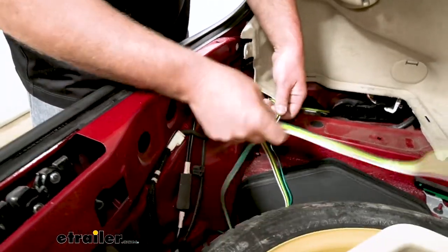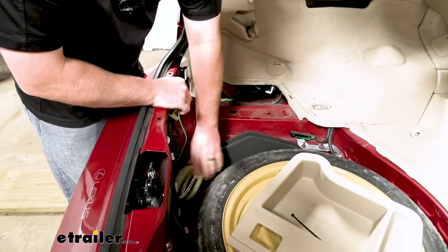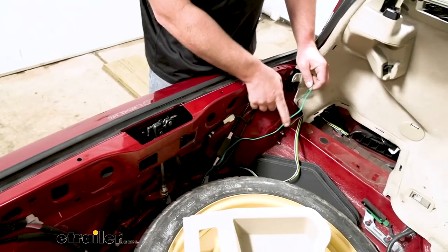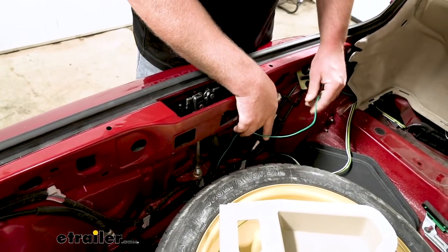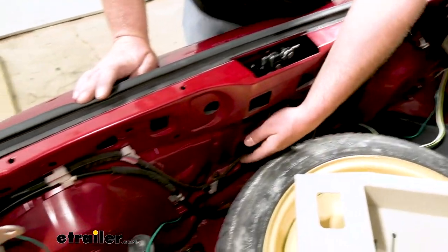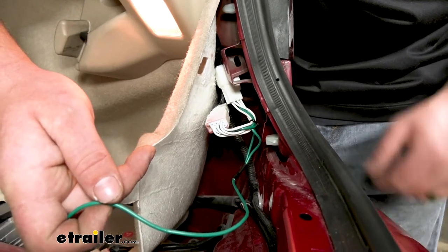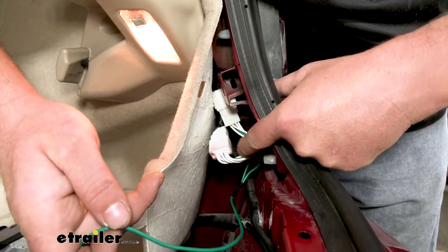The white wire with the ring terminal and the black power wire, we're just going to let that chill for now. The four-way flat connector wire, I'm going to ball this up and store it down here — this is probably the area we'll keep it when we're all finished up. The green wire is going to get routed over to the passenger side. I just loosely routed this and won't secure it just yet — I want to make sure the wiring works before I get too carried away. The green wire runs all the way over and tees into the factory taillight wiring on the passenger side, plugged in the same exact way we did the driver's side.